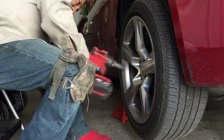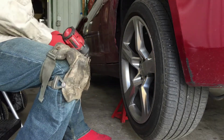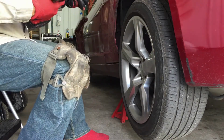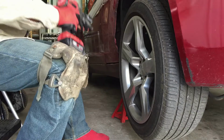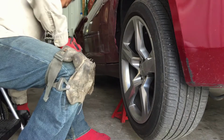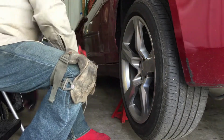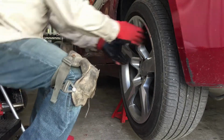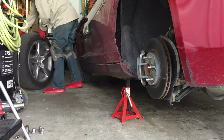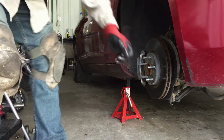And we had to replace some of the studs on here on all 4 tires, or 3, and one was good, but we did a replacement. The back one I didn't do, another guy did it, but he said he needed to pull out the wheel bearing a little bit to get to it. So if you have to do that, that's what you're in for. So this worked better. These standards worked a lot better. The metrics I was using last time were getting stuck and I would have to get a screwdriver and put it on the vise and hammer it.